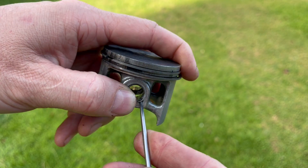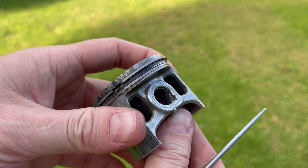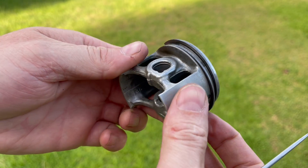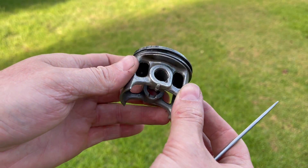Then simply lift that pick up and push it inwards, and the circlip will slide down and into its groove. You should hear a click, and if you don't, look closely and just make sure that it's fitted in the groove all the way around — if not, take that pointed tool and gently press it in. It's important to remember to keep your thumb at that halfway point, and it may require a gentle bit of persuasion with your thumb to get the whole clip into its recess.